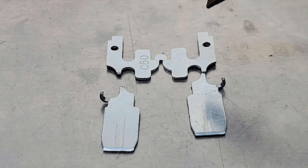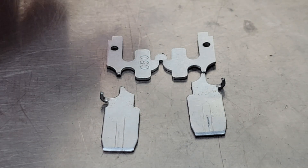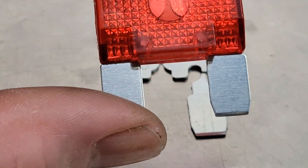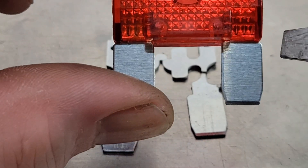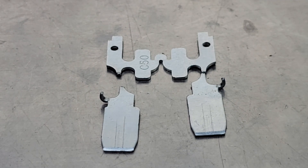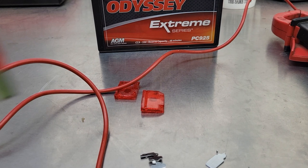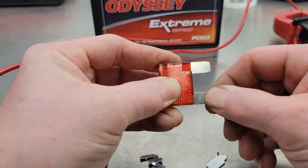So you start checking wiring and everything else under the sun. Then when you go to take a closer look, always give the fuse legs a wiggle — make sure they're intact. That fuse has been pulled in and out dozens of times and the leg can break down and break. Here's a new fuse — these legs are nice and secure.